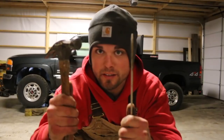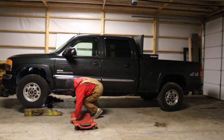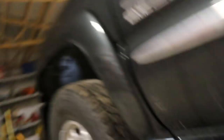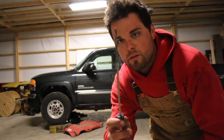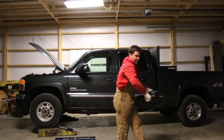I need a screwdriver and a hammer — this is what I resort to. I give it a couple tries and if it doesn't come, I'm not wasting my breath on it, I'm gonna get it off. So we got the oil draining out and I poked a little hole with the screwdriver in the oil filter to let that oil drain out before I bust through it. You've got two oil streams going right now. Whoever put this oil filter on should be punched in the face — I drove this screwdriver through trying to pry off the filter and I bent the screwdriver. It should never be anywhere close to that tight. I have to get a bigger screwdriver.